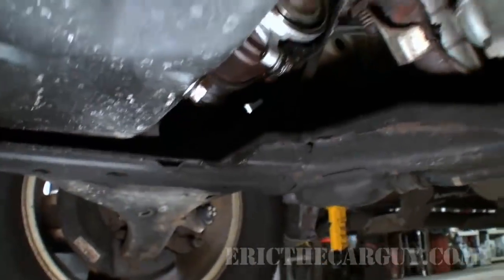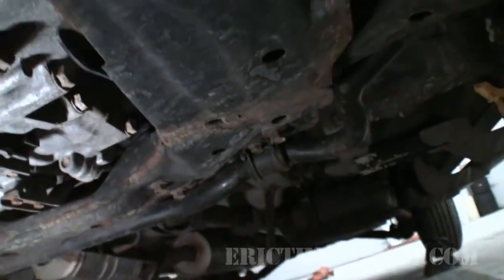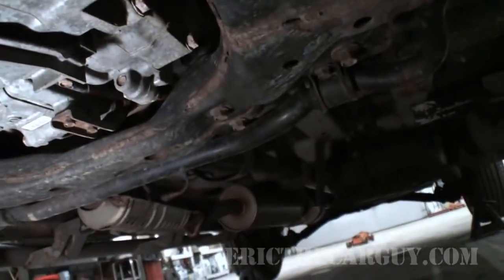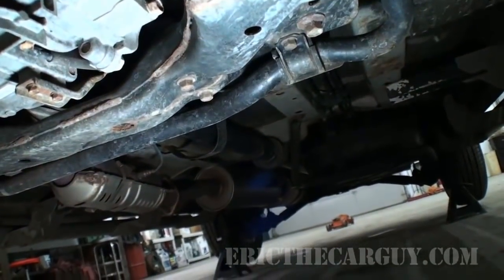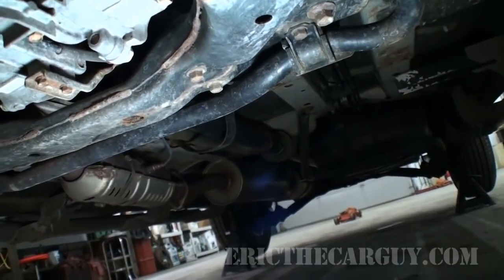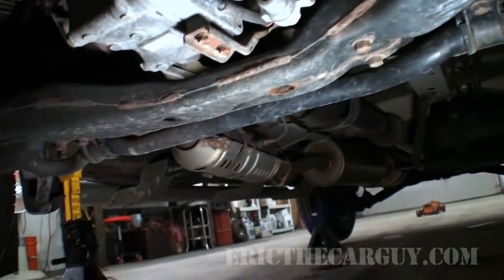It's a perfect time. And look for oil leaks, abnormal oil leaks, coolant leaks, any of this stuff that could potentially be a problem in the future. Also, go up under the drive shaft and shake it a little bit and check around for any looseness there. You're looking for loose parts, you're looking for worn out parts, you're looking for basically problems before they happen. That's kind of the idea with the maintenance. Check the exhaust, look for leaks.